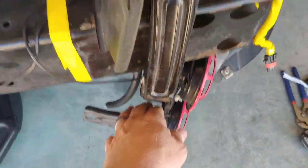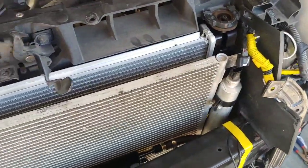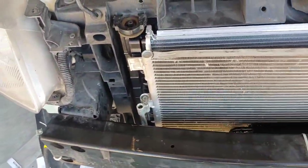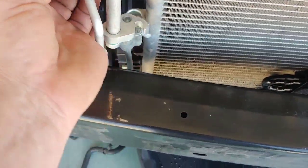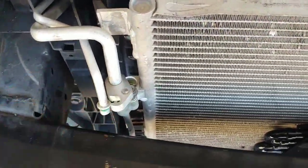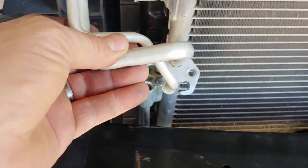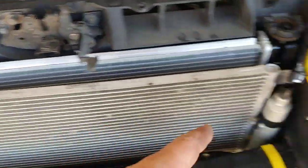At this point you're gonna have to deal with your condenser, unless you can find a way to hang it so you can take the radiator out. Since I didn't have any R134 left in this system because of an earlier leak, I didn't have to worry about it — I just unbolted it here. Remember, if you have R134 in there and you take this bolt out, it's gonna spray and you're gonna lose all your refrigerant. I also removed this bolt back here so I could take the whole thing out so it's not blocking or sitting in front getting in your way.